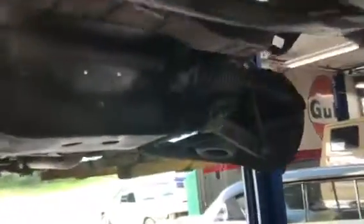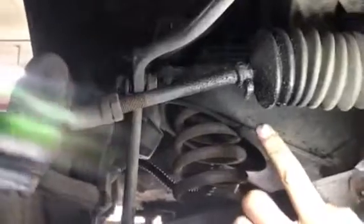Looking at the underside of the MGB, this is the steering rack. This boot is leaking pretty badly. On the suspension, this bushing — all the lower control arm bushings — they're just falling apart and getting pressed out. These are all going to have to be replaced. There's a very minor oil leak right here from the steering rack; it's kind of common, not a big deal.